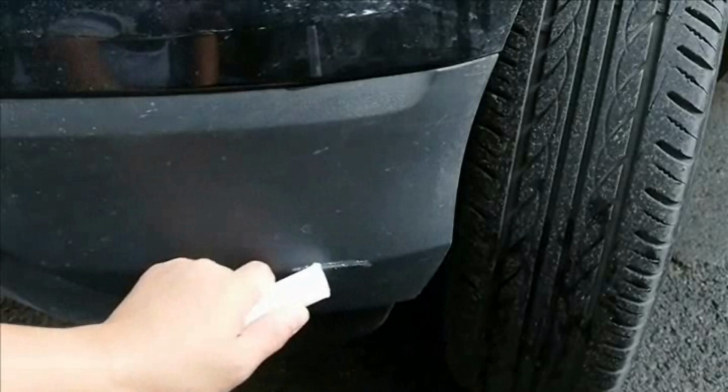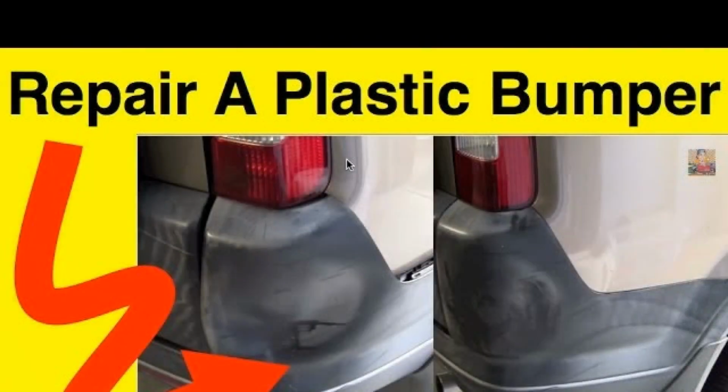1. Apply friction compound. Polish the scratch with friction compound. This is specially formulated to level scratches in the same way as sandpaper. It's available in a range of grits from 1000 to 5000, so choose one that best suits the depth of the scratch you're trying to get rid of. Apply in small quantities for faster drying time. 4. Apply varnish. Once you've achieved the desired finish, apply varnish and buff to the desired shine.